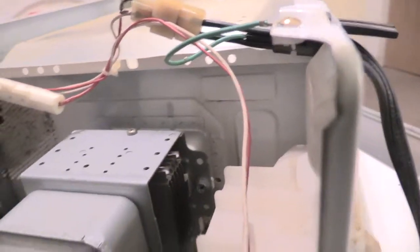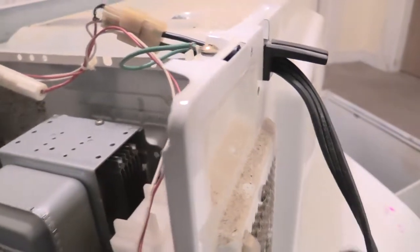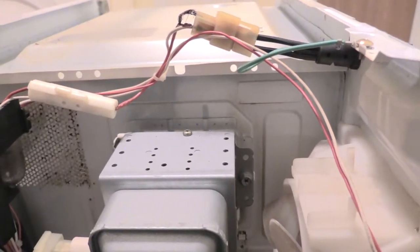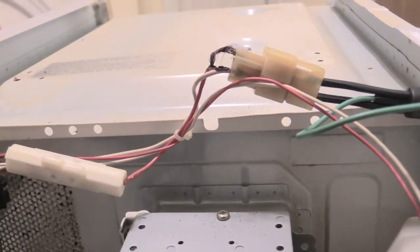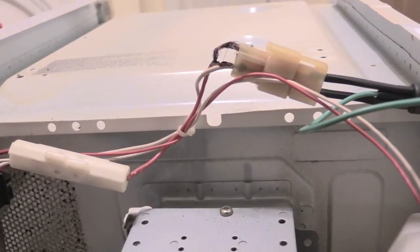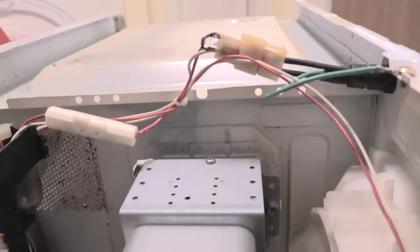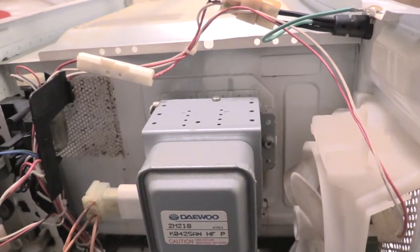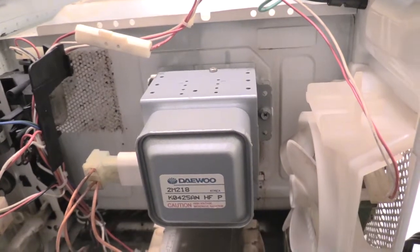If you have a microwave like this that has something wrong with it, I would say don't just set it outside somewhere, because somebody else may come along, pick it up and take it home. They'll plug it up and even though the wires are burnt up they're still making contact, which means the microwave will still work — but eventually it could catch on fire. So if you're going to throw it away, go ahead and completely cut the cord on it. That way if someone finds it and wants to use it, they'll have to open it up first and see this problem. Alright folks, these are some possible problems and quick troubleshooting points — please check out our other videos and subscribe, thanks.